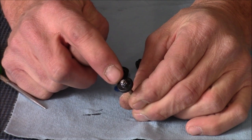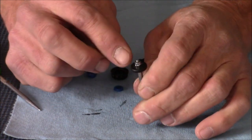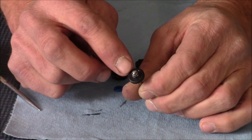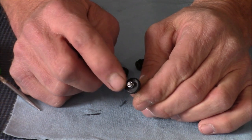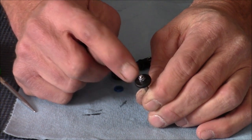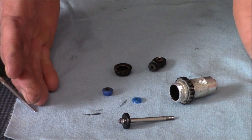If you're going to remove your piston and swap it out, all you need to do is take this nut off - there's a washer underneath the piston as well, so pay attention. Pull the nut and washer off and the piston will come off. There is a number marked on the piston; it's really hard to see - you need a magnifying glass or good light. When putting the piston back on, don't flip it over; put it back the same way it came off with the number facing the same direction. Keep it going the same way.